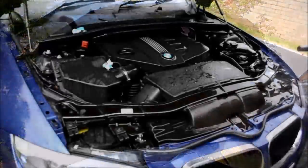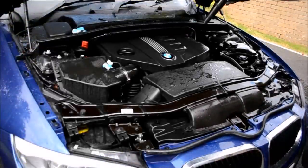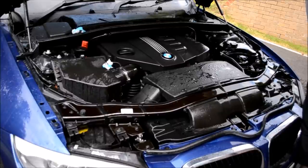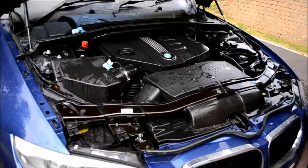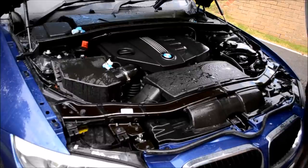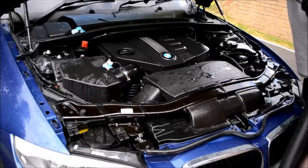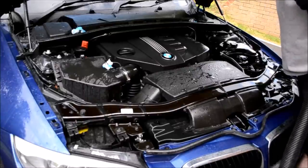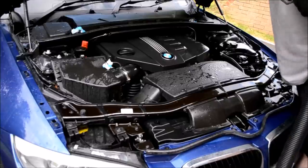My chosen method to dry the engine bay is using a Metrovac Master Blaster. Alternatively, you can use microfiber cloths, it will just take a little longer. I find the Metrovacs do an incredibly thorough job, allowing you to remove standing and trapped water from the tightest gaps and crevices. Whichever your chosen drying method, ensure all accessible areas of the bay are respectably dry.